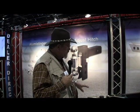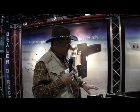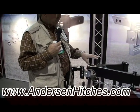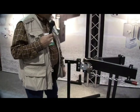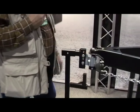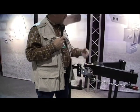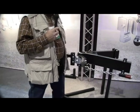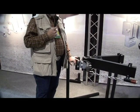This new feature from the Rapid Hitch folks does both those concerns. One part fits all, which is kind of unique. Instead of spring arms or chains that hold the spring arms up, you have a chain that does it all. It goes out of a cushion that controls sway as you get side-to-side tongue movement. It can be quickly attached with just one pin. In the horse industry, you can leave basically everything on the trailer and use an adjustable coupler. All you have to do is use your trailer jack to relieve the pressure on the chains, and then it's freed up — take that off, unhook your coupler, and go. Most systems require you to take off all your spring arms or chains, so this is a very unique system.